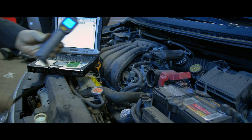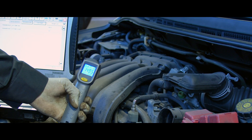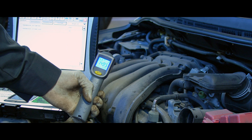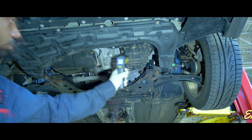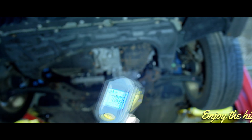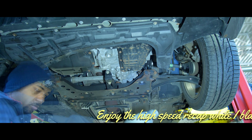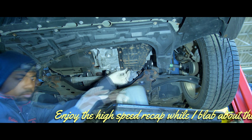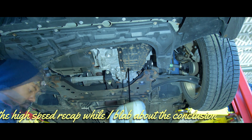In conclusion, we can see that the temperature on the pan — the drain bolt specifically — seems to follow the ATF temp count by a few degrees at the start of this test, showing about a 4-degree temperature difference, with the trans pan being 4 degrees cooler. But towards the end of this test, we end up with a temperature gap of about 11 degrees, with an ATF temp count of 160 and a pan temperature of 149 degrees using the temperature gun pointing at the drain bolt.